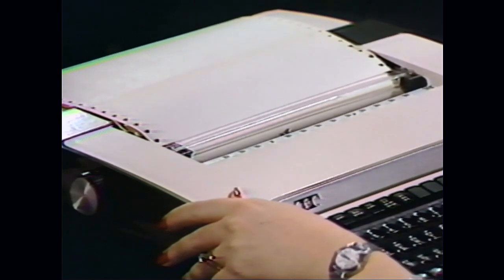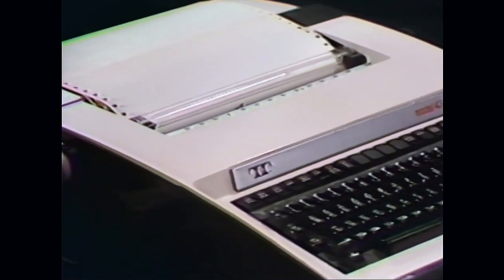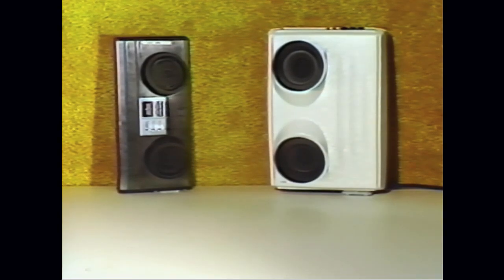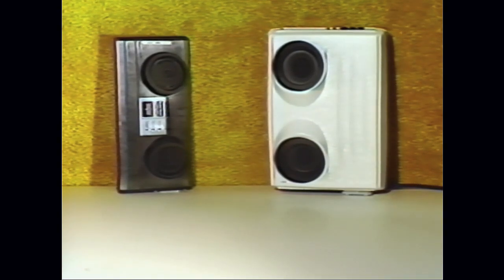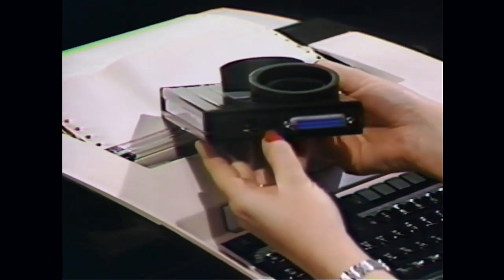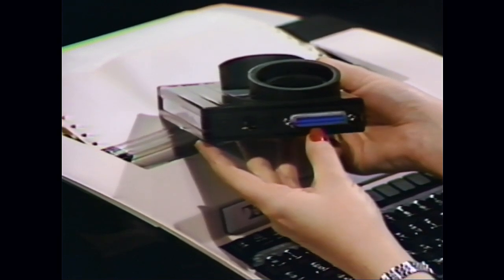The terminal and acoustic coupler are now ready to be attached and the power supply connected. You will have received one of two acoustic couplers, either a Radio Shack or a Tech Com. The acoustic coupler is used to connect the terminal to the telephone lines, which transmit the data into the computer. On the back of the Radio Shack coupler are the power switch, the plug for the power supply, the transmission mode switch, and the plug for the terminal connection cable.